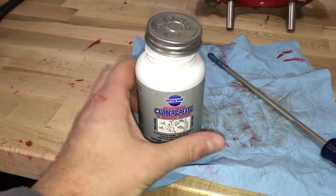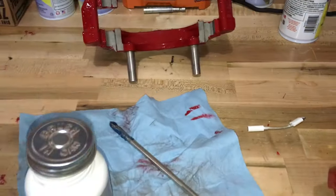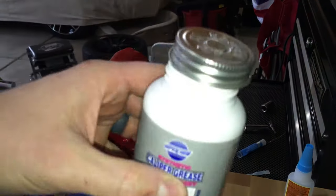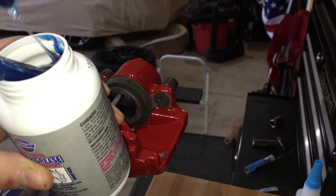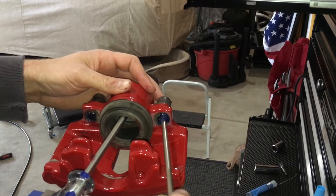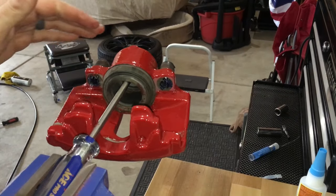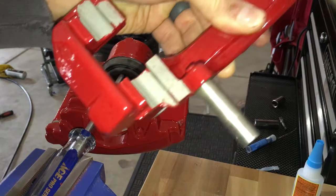The next thing we want to do is grease everything up before we put everything back together. This is caliper grease — we are going to lubricate both sliding pins on each caliper as well as put lubricant inside each one of the rubber grommets on either side. The easiest way to do this is to take a long screwdriver, stick it down into the grease, get a bunch on your screwdriver, then run it into that grommet hole and wiggle it around a bit. Scrape it against the outside as you pull it out. We'll also put grease on each one of the pistons that go in there and lather those up well before they slide in. And we'll apply grease on these four contact points as well.